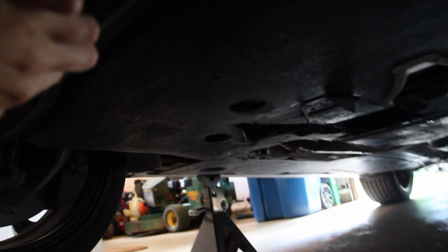Underneath, there is a cutout for the drain bolt. If you're familiar with the E39, it's a 13mm hex bolt. This car, nah, I needed something more complicated. We come all the way back. Here's that front jack adapter. We go another 12 inches back in the center, and there's a circle cut out of the belly pan. And if you look in there, there is what looks to be a 6mm Allen head drain bolt. I don't know why they did that, but they did.